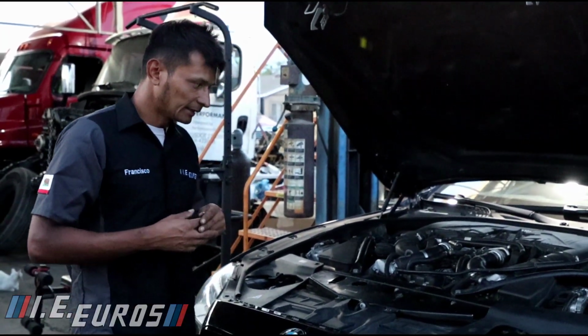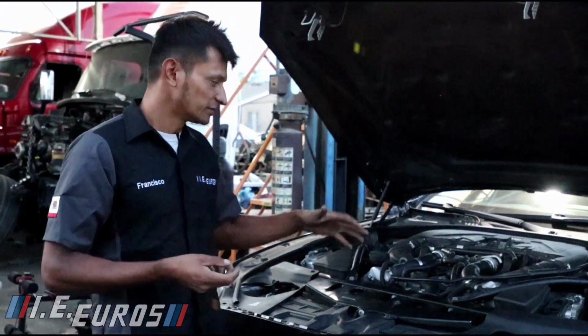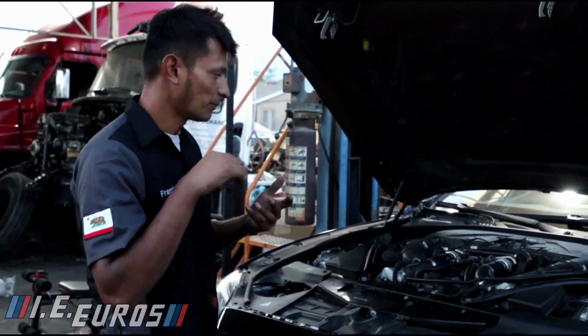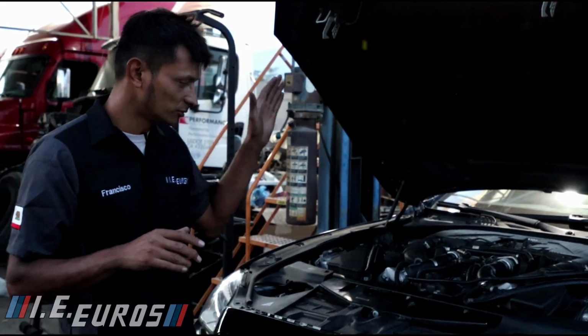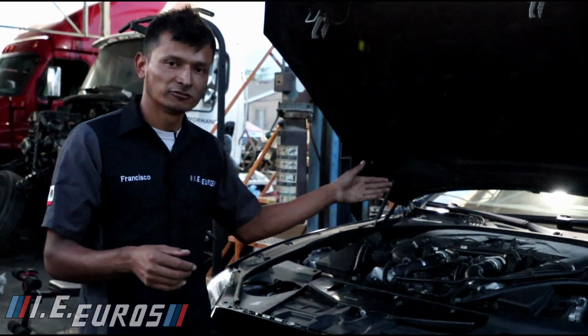And just to give you a different idea on what drivetrain malfunction is, you can see this has nothing to do with spark plugs, coils, any type of vacuum leaks, nothing like that. It is something completely different than all that. It is boost control, a little solenoid that has 2 pins. It was causing drivetrain malfunction.